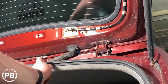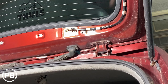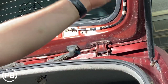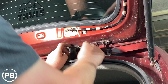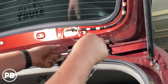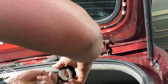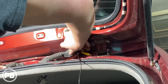We're going to start preparing our wiring. We have to go through this grommet — you can see there's factory wiring there so we know it's a safe location to run our own wiring. We need to pop both ends of the grommets out and pass our video wire through, coming out into here and running along all the way to the camera. I have this old metal hanger we're going to use as a fish — get it all the way through and hook our wire to the end, feeding the wire through.